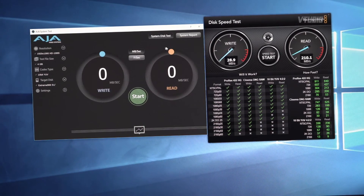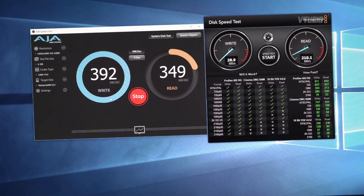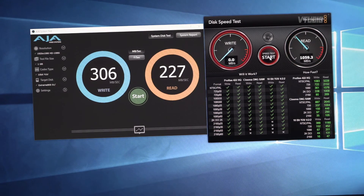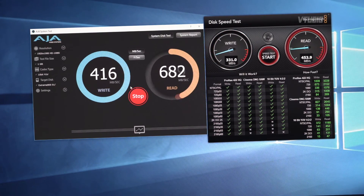Over in Windows it was just plug and play — wait for the updates to occur. I'm connected to an SSD plugged into my NAS, and getting fast speeds: about 500 megabytes a second is the fastest I can get this SSD directly connected to my computer. Over the NAS it runs slightly slower, but 400 megabytes a second is pretty much how fast it writes over Thunderbolt 3 directly. Over a thousand megabytes a second on reads — that's primarily because we're using the cache rather than the disk.